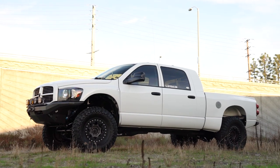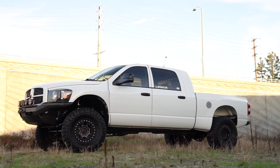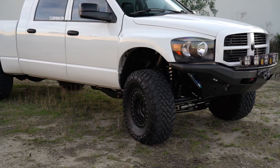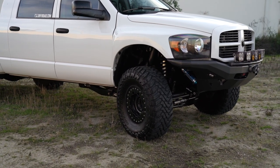I've got a RevMax 550 with a billet input shaft — that's another important thing. Even if you guys don't have a lot of horsepower, I've broken a stock input with a stock motor running hard in the desert because of the shock loading. So you're going to want to go with a billet input with any serious off-roading, because the shock loading will snap your input. I've learned that the hard way.